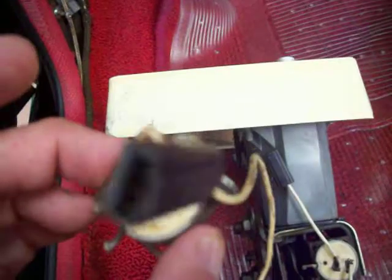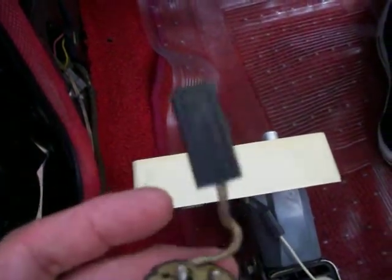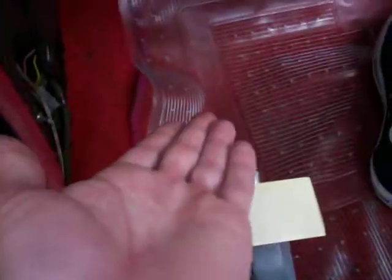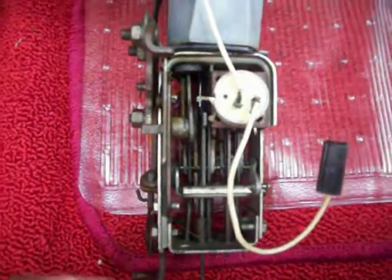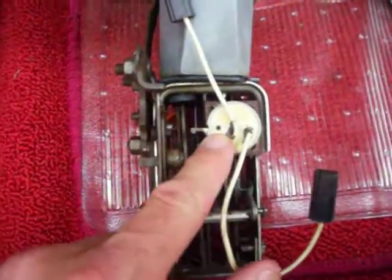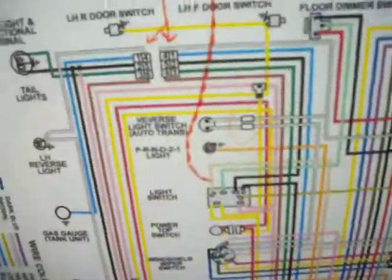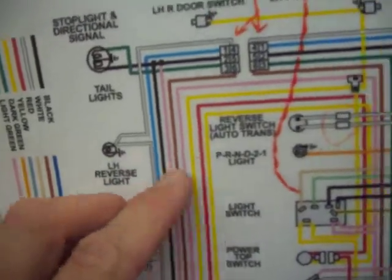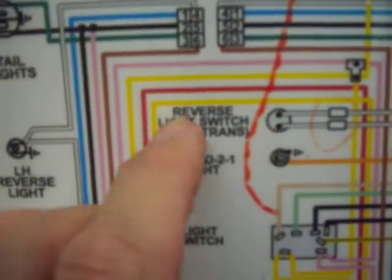Here's one that I've taken off another one. You can see the little prongs here — looks like little antennas on a bug. The best way to know if your car has this is to get down and look up under the dash. You'll see the push button, the cables coming out for the brake and for the transmission, and then you should see this little disc with the two white wires. You should also have sockets in your reverse lights. This is the reverse light switch.